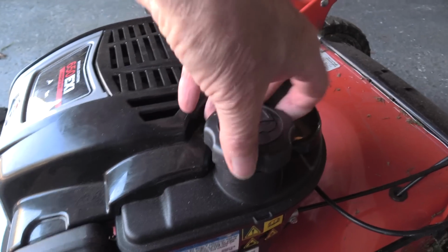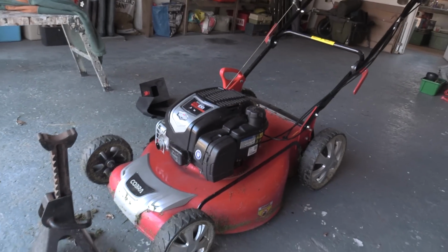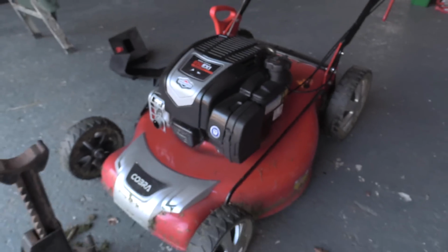And indeed the lawnmower man was the same, or the lawnmower lady. So she tried to sell me this stuff. Okay, so they do a pre-mixed Alkylate petrol for 2-stroke machines, and an Aspen 4 it's called, which is obviously a 4-stroke Alkylate petrol for all types of 4-stroke machines. And indeed they show you pictures of a piston from a hedge trimmer and an exhaust port from a chainsaw after 350 hours, compared with the oxidisation caused on pistons by normal stuff. And very impressive. It's like being polished by Brasso or something like that.